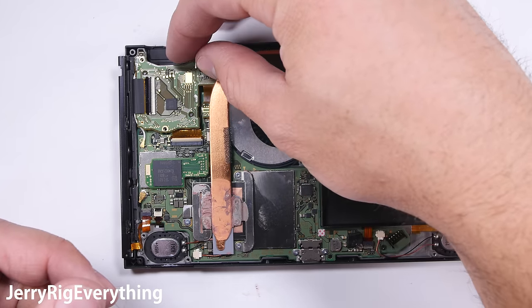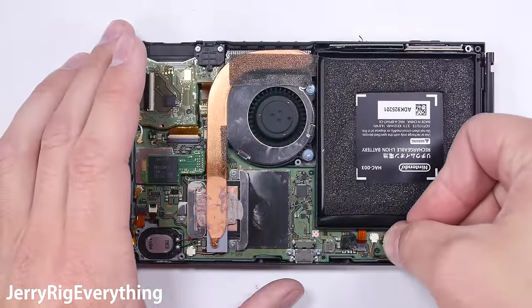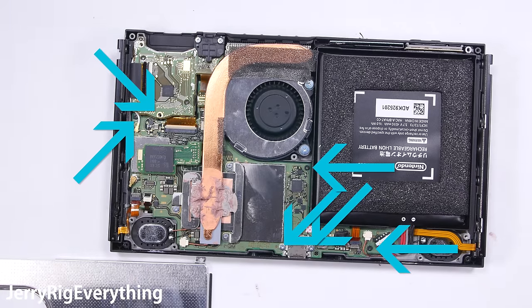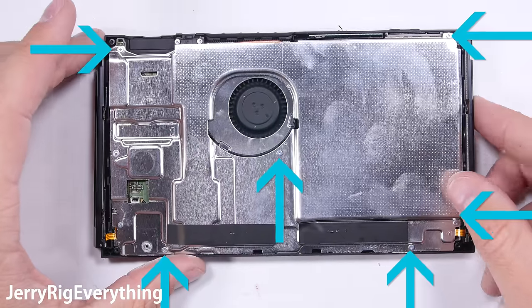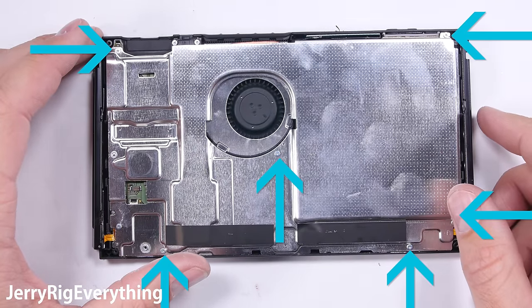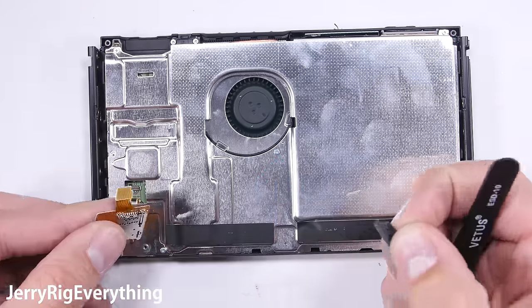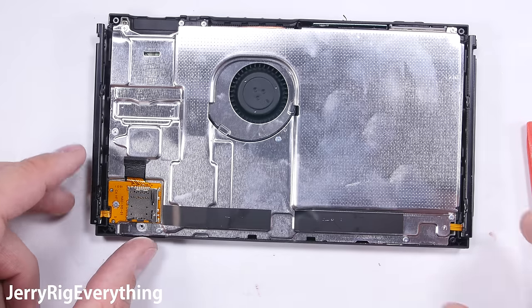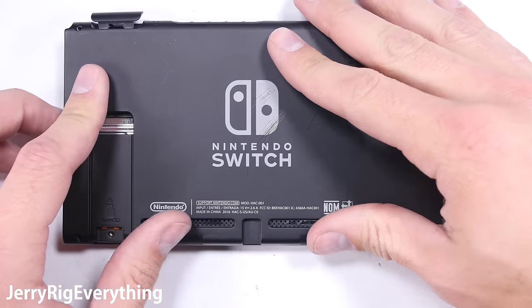Set down the black plastic bracket over the headphone jack, then place the 4,300 milliamp battery back and plug it in — just reusing the same adhesive, but a new battery will probably come with its own. Get all motherboard screws into place. The black tape on the metal backing is a super cheap way to keep silver from shining through the grill slots — a cost-effective way of keeping the console looking clean and blacked out. A final screw goes next to the SD card slot after plugging it in like a little Lego and affixing the foam pad over the top of the connector to prevent accidental disconnection if dropped.